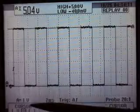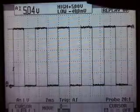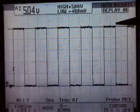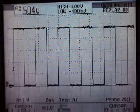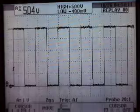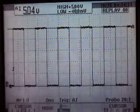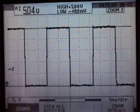That'll give us an idea of how to set our channel A voltage scale. If the pattern was going all the way up on either side and we couldn't see the top cutoff points, we'd know our voltage scale was set too low and we'd need to go to two volts per division. If you wanted to look at the ground side switch, we could hit the zoom button and try to zoom in.